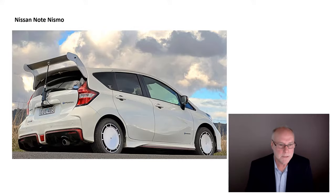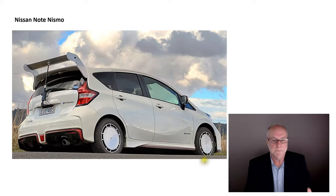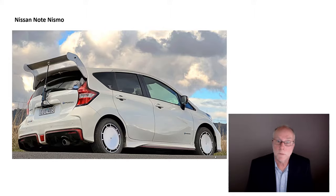In this shot you can see the little pizza-lid dishes I've added to the wheels to reduce wheel drag. You can also see the front air curtain, and what you can't see is the front curved undertray I've added that provides real downforce. That's the reason for the rear wing — if I increase front downforce, I need to increase rear downforce as well, or it's going to be more prone to high-speed oversteer. You can see here the wing I'm describing in this video.